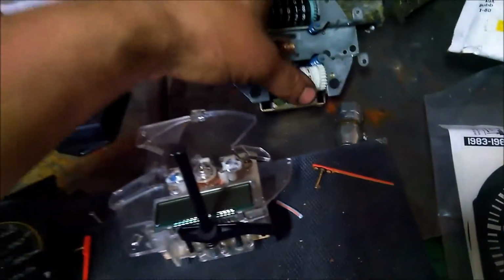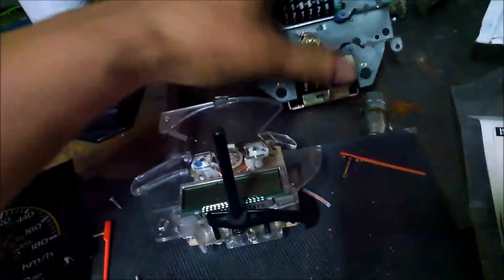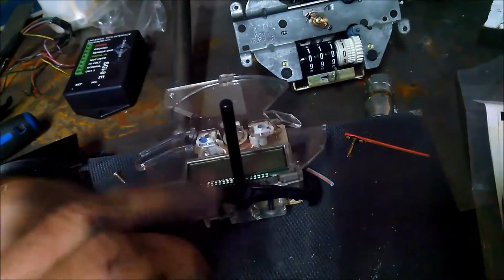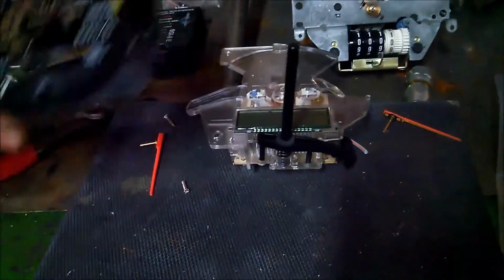We're using the Kia one because it has the reset in the same spot as the Mustang. It has that little square knob that goes to the circular knob on the clear plastic cover. So this one can still work, and we have to cut it down so the plastic knob, when you push it in, is still hitting that. It's going to have to be recalibrated because the sweeps are different.